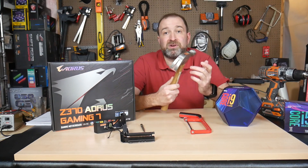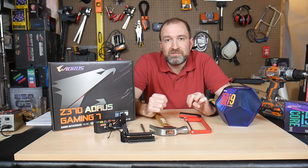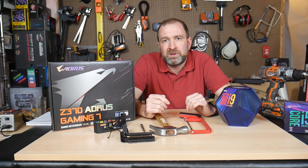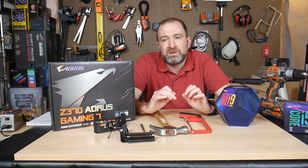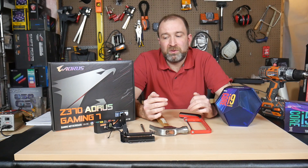After that I started playing with overclocking a bit more, and felt comfortable running it at 5 GHz with no AVX offset. I had 1.29 volts going through it, and a 4-hour RealBench run was perfect. I tried 1.285V, and it was mostly stable, but every now and then it would throw an error in RealBench. I don't know if I'm going to put it under a full Prime95 AVX load — it seems like a lot of people are moving away from that.